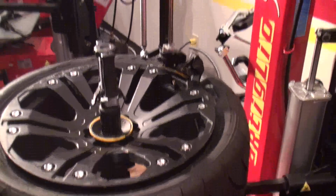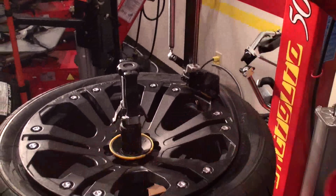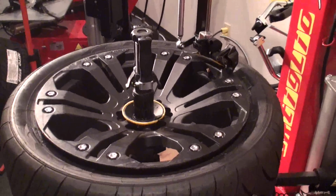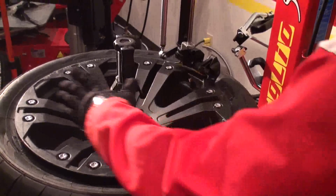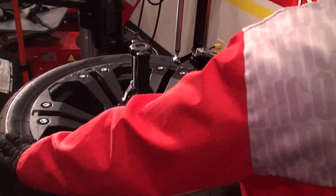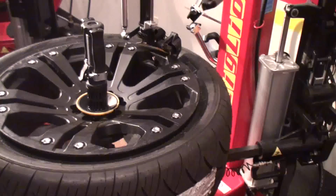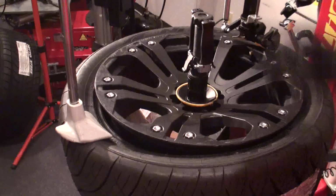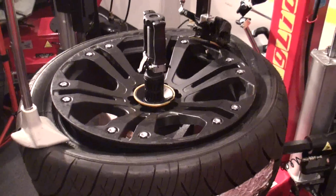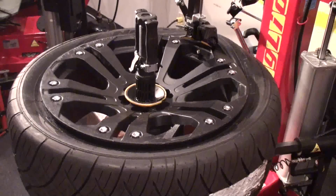In some wheels, when you pull this up, of course, if it at the opposite is not in the drop center, this finger will not do it, but that's on purpose, because if it's not in the drop center at the opposite side, this will ruin the tire. So what you want to do, if you have this accessory, you just can hold it down there and then pull up. This will be even easier.